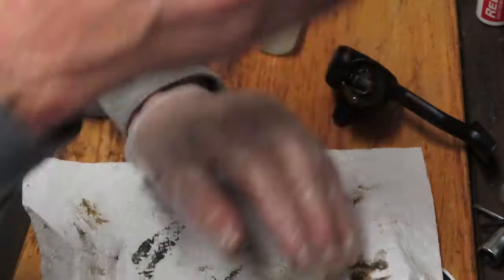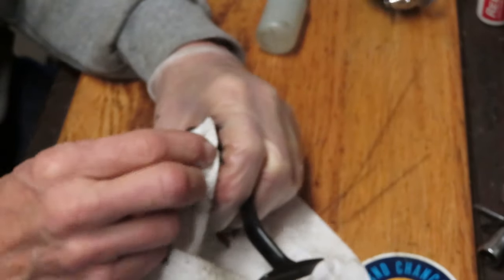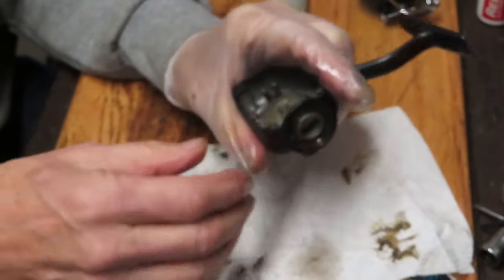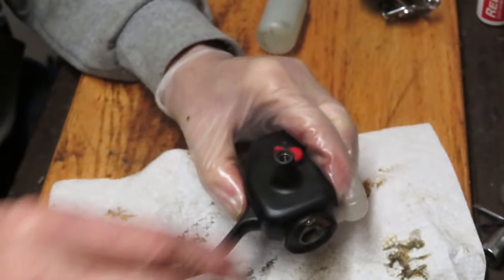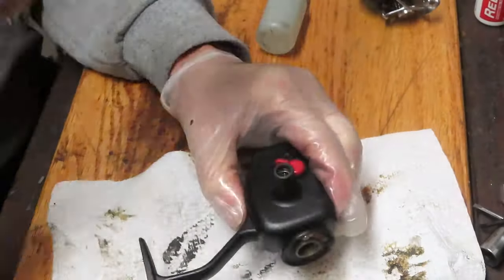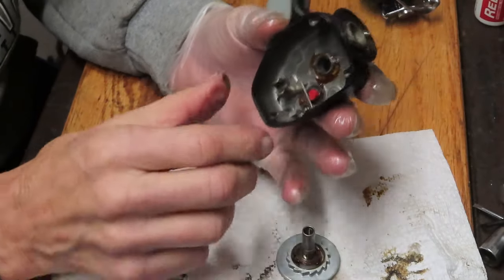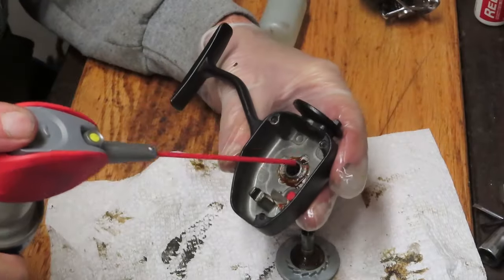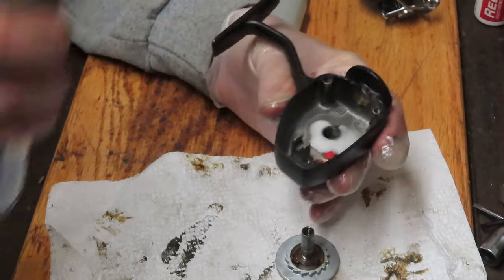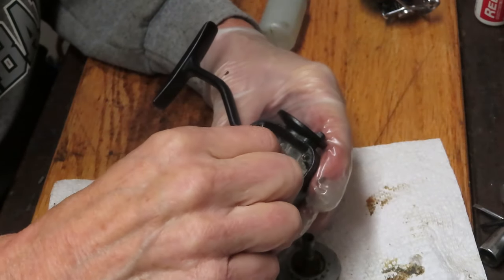All right, that's the rotor. There's only one piece left in here. There's some cleaning we've got to do. This is the trip lever. But the only other piece is the main gear now. I'm going to just turn that up. Let me just grab it. Oh, look at that. It's coming out all by itself. Isn't that nice? We have some dried grease behind there. And the penetrating oil works great as a solvent. So let's go ahead and use that. I'm going to grab another cotton swab and mop up.